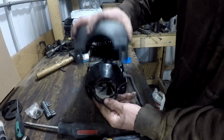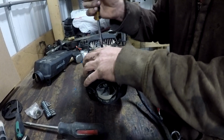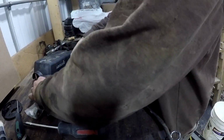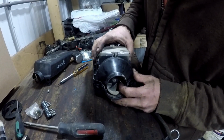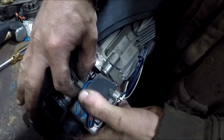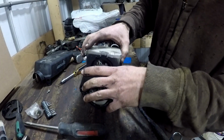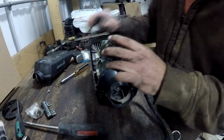First, we're going to take the heater out of its plastic case. Remove the T20 torx screw that holds the control box into the heater. Pull it up and disconnect the wires. The wires are keyed so that you can't accidentally plug them back into the wrong spot, so you're pretty safe to just pull them out and remove the control box from the heater.